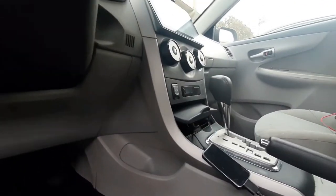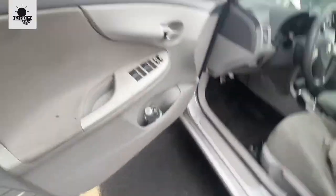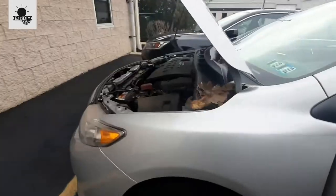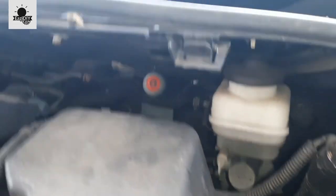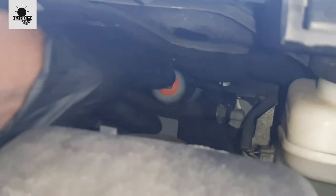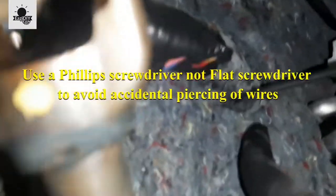In this video I'll show you how you can run a wire from under the dash of your car to the hood of the car. There's a firewall grommet you need to run the wire through, and all you're gonna need is a long Phillips head screwdriver that you're gonna poke through the firewall and catch the head of the screwdriver on the dash of the car.